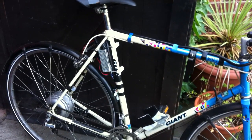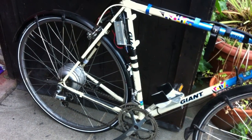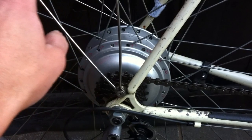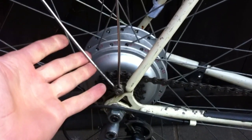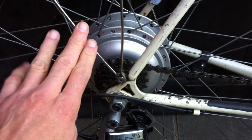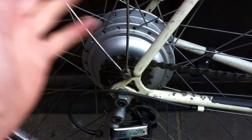This is the first e-bike I ever made — I call it the stealth bike. It's my old 1991 racing bike, fitted with an internally geared hub motor off a 20-inch wheel, strung to a 28-inch 700c wheel to give higher RPMs. So it's effectively a high-speed hub off a shopping bike. I wasn't so much interested in power, so it's not great for hills — what I wanted was top speed. This is a land cruiser for flats.